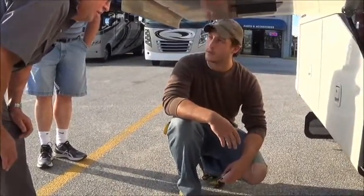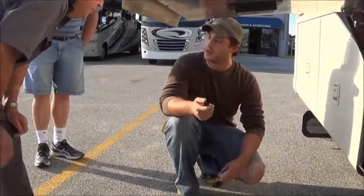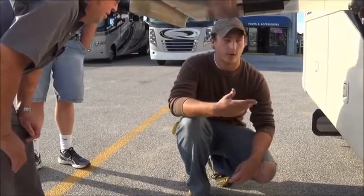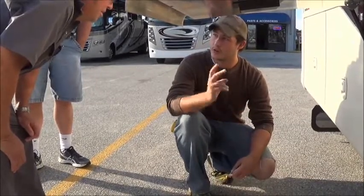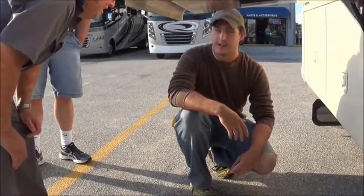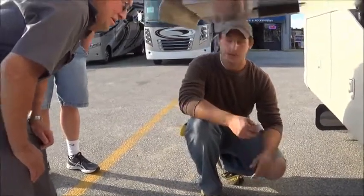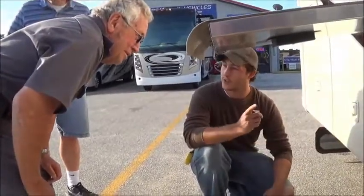They've got fillers. If you ever go to a truck stop, they have actual DEF fill stations just like if you were going to fill the diesel up — they'll be marked DEF. Or you can buy this in gallon jugs, assorted sizes. I'd always keep a gallon or two on you. If this gets too low, the truck will go into limp mode and it'll only go about 20 miles an hour. You need to stop before that tank gets to about a gallon. Keep an eye on the levels — you can check it here or on the dash inside.